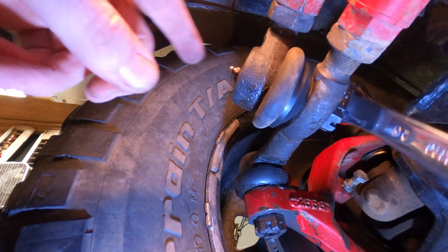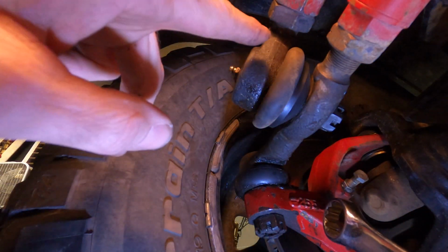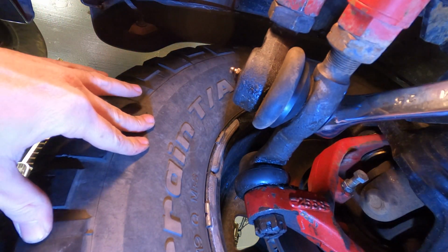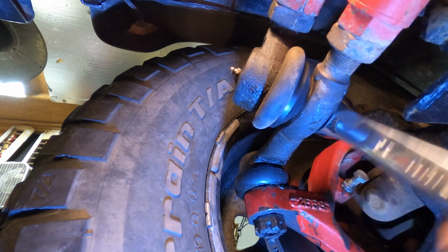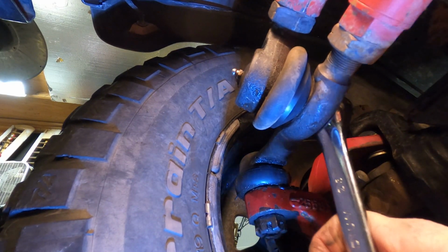Now, as you can see, now we're getting to where it's starting to snug up and it's starting to push everything flat. Like this flat right here is gonna be flush with this. The backside flush is gonna be pressing against the ball joint to where it is secured and everything kind of locks in and doesn't wanna twist down and everything. But I wanna make sure I get this sucker really tight so that it seats down just right. Got that all tightened up.